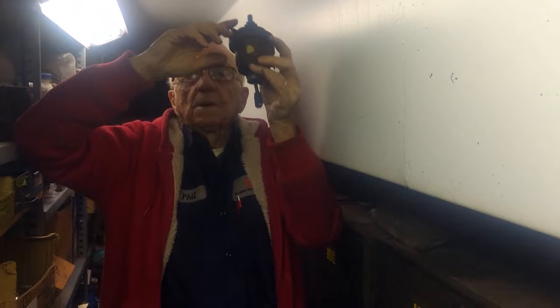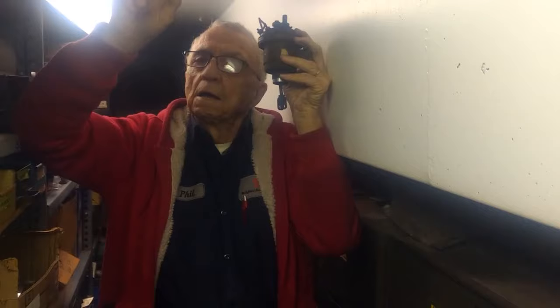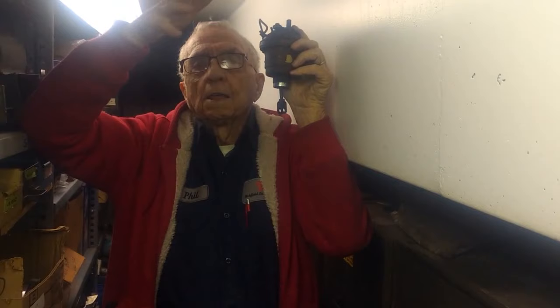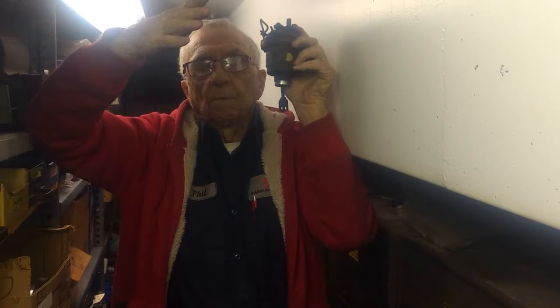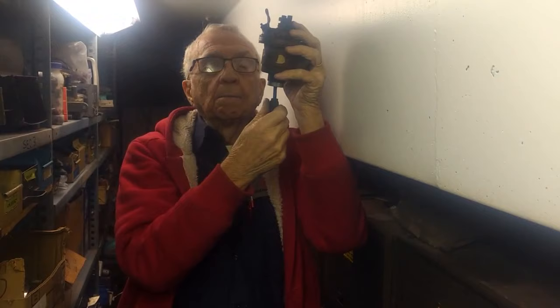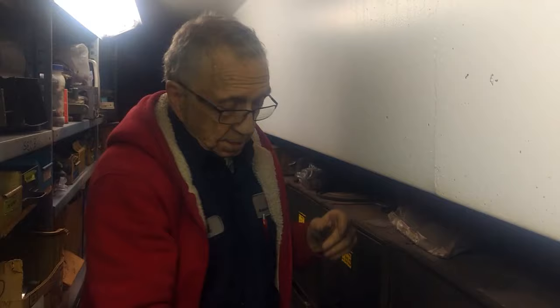Those of you with 71 series engines, there are two things you do before you even try to start one of those engines. The first thing, Scott, Bus Grease Monkey, warned you about, make damn sure the fuel racks move before you crank the engine, because when the engine stops, the racks open wide open, or almost wide open, and the injectors will stick there and lock that into that wide open position, and when you start the engine, it's going to take off and run wild because they're stuck, they can't back off. The second thing is the emergency stop. Make sure that works. That's an electrical switch. It pulls this and flips a diaphragm on the air intake. And you have seen me do that on the transits on one of my earlier videos.